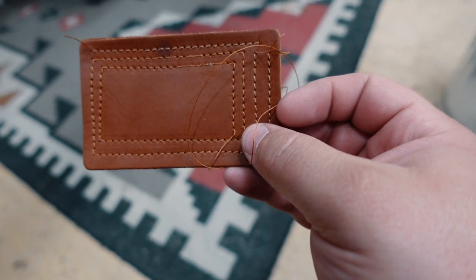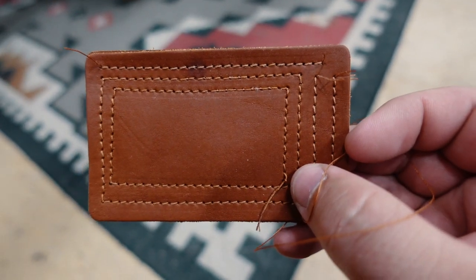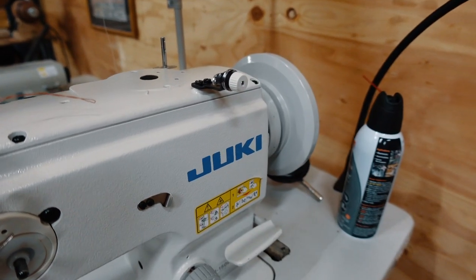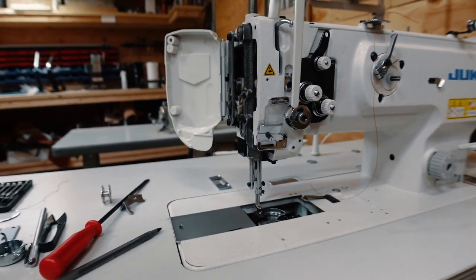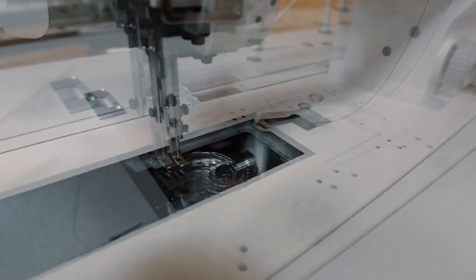When you've got it looking right for half the stitch and then the rest has gone bonkers, it just makes it a much more difficult problem. Before all the keyboard experts start chiming in, I'll tell you what I've tried. I've tried a lot of different tensions on the bobbin winder to make sure the bobbin wasn't being wound badly. Quadruple checked the thread path every single time. Nothing's being caught up. The machine's been well oiled its whole life. I just got done adjusting the hook and needle timing with and without the presser foot spring. Different tensions with the check spring. Thread stubs are cut short on the bobbin. Every different size and type of needle. I've tried every type of weather in our shop. It's about 9:30pm and I don't feel like I've made any progress. Send help.